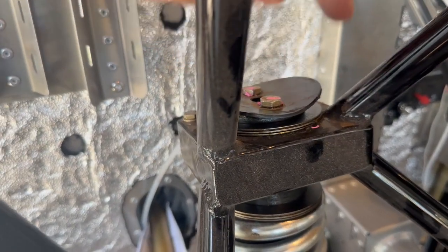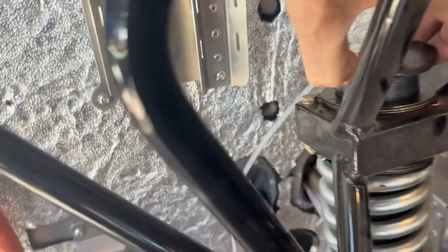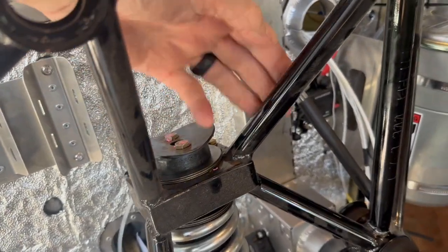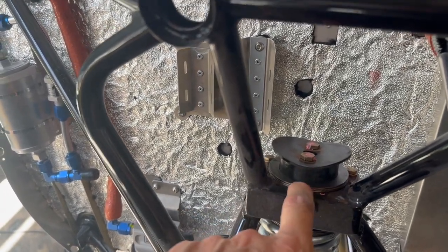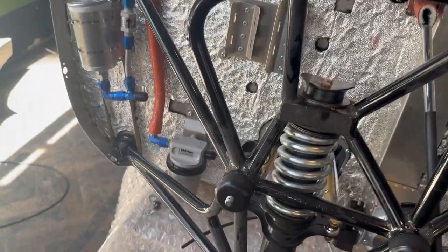I had another look up here and that is obviously not supposed to look like that. There's supposed to be a yellow spacer in there that holds this thing up, and then you don't get the scraping. Clearly, when it was shipped, the airplane must have had the nose gear tied down to the bed of the truck. It's taken a hiding - it's pulled the whole frame up from the nose gear, which was attached to the truck, so it's broken the spacer. It's plastic, and as it's split it's rocked out to the sides and bent this upper plate.